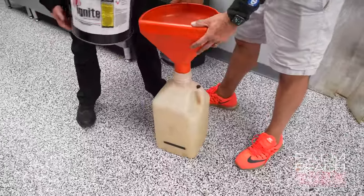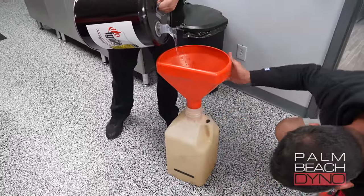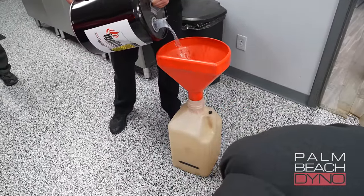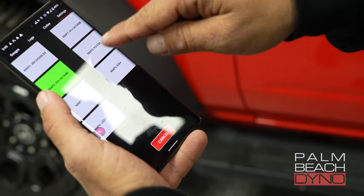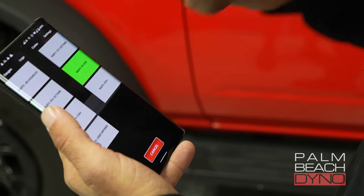Map three. They want E30 — so if it's near empty, we put one gallon of ethanol in. I was skeptical, but I wasn't considering how they're adding the power. How do you feel about putting race gas in a brand new block? That is not race gas — that is an E85 ethanol-based green fuel that we use here. So we're changing it to map three, which is 93 octane and E30. To make it E30, we put ethanol in it.